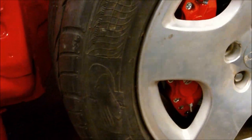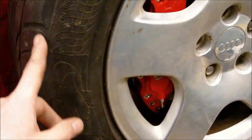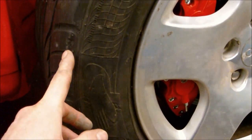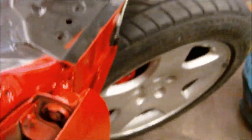This is with the 17 but it's got a 55 profile. A 20 with a 35 profile will still be exactly the same size tire because I've done a tire size calculation. So I've got all this room — loads and loads of room — and it doesn't move when the suspension goes up, so it's always going to be the same.